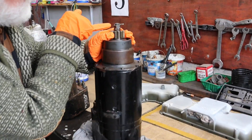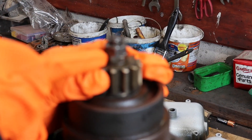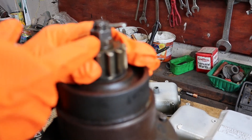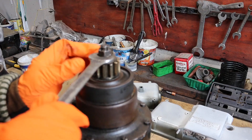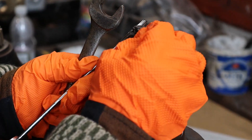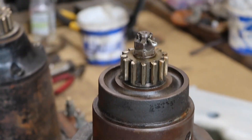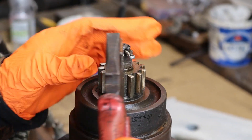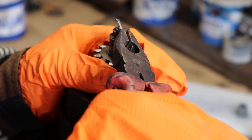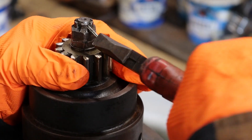If you study in here, you'll see we've got a main castellated nut, and in behind that a lock nut. This is a wee bit unusual, because usually the lock nut goes on the outside of the main nut, but on these starters it's on the inside. So it's important to have a spanner that'll fit in there and move freely, independent of the big nut. There's a split pin in there which is often completely rusted. The first thing you do is take that split pin out, or you might decide to leave it in until the lock nut is slackened.